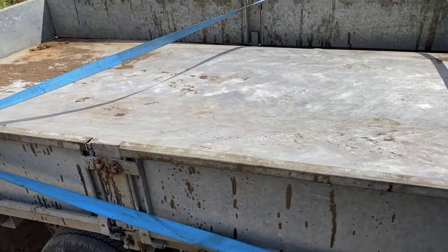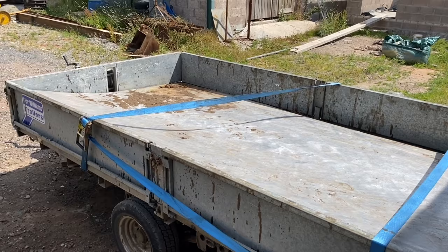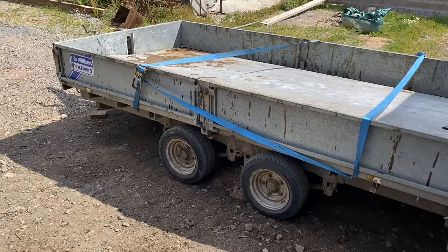So I've bought a pack of deck rings off eBay. When I put this aluminium in, I'm going to coach bolt the deck rings into the chassis rails so we can strap from the inside. Also some of the eyelets — this one there has been snapped off. It's just had a hard life, this trailer. The last owners have used it. So we're going to put these deck rings in to make it a lot more usable.